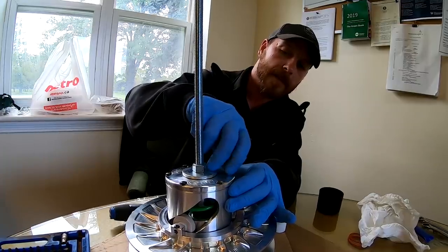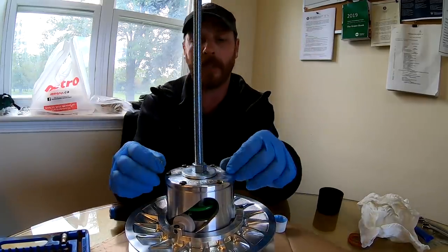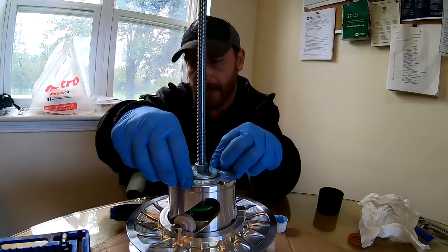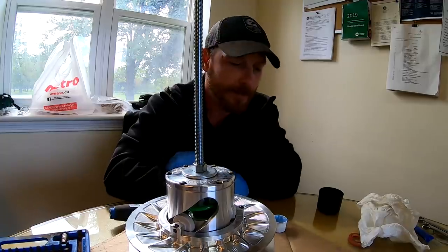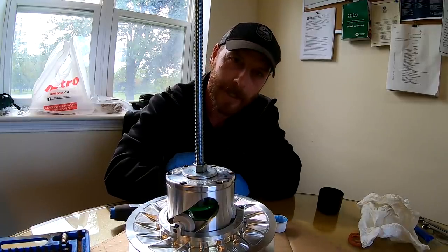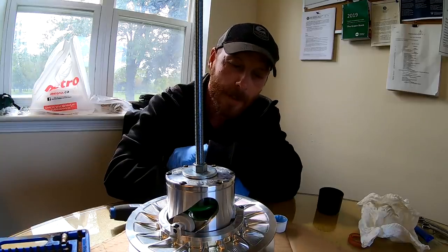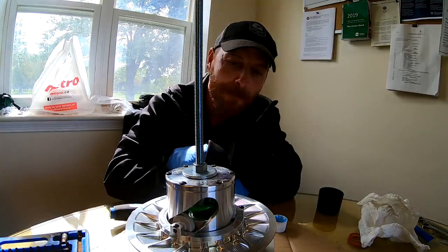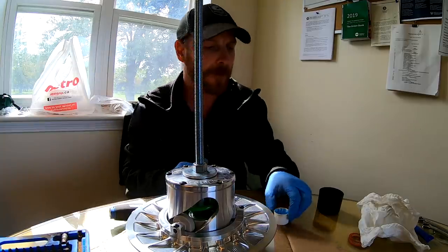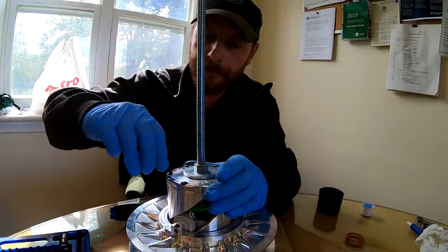We've actually had two different types of setups in the secondary recommended to us, but both did come with two shims for backlash. One recommendation being a gold spring, which I did order up. STM had recommended maybe I try going with the lime green, which I think is better suited for heavier weight machines like side-by-sides — but they recommended it to us because we're running something a little bigger than most people do on an ATV, a 34-inch, which sort of represents the load of a side-by-side. So we're going to go ahead with STM's recommendation of the lime green, find out how that works, and if we're not getting the performance we want, we'll probably take Adam from QSC's recommendation and throw in the gold spring. Asta and Keith and a lot of other folks have been running the gold spring, so it definitely works — but we're going to try this. Very curious.